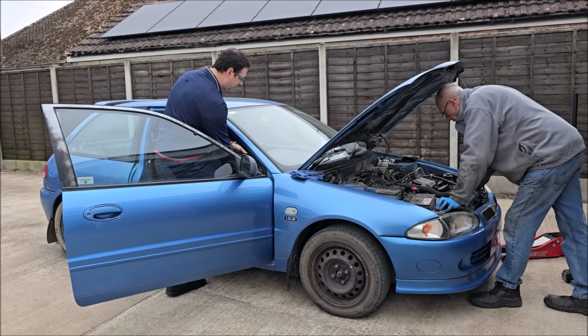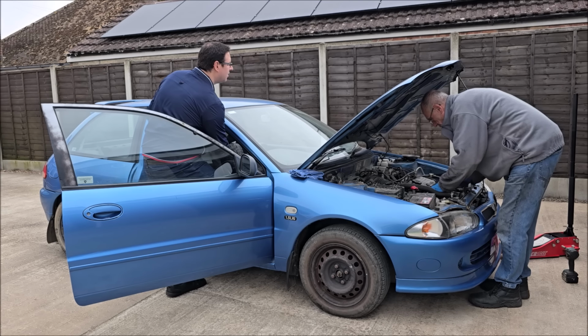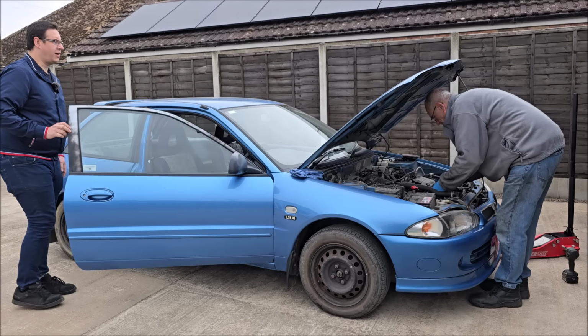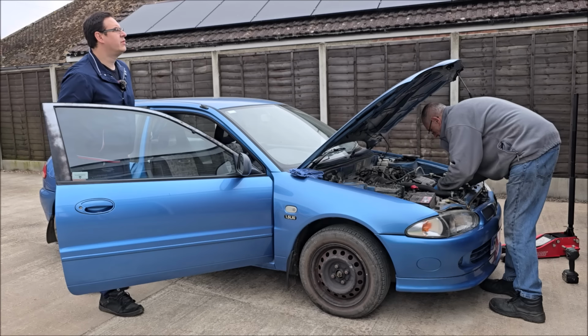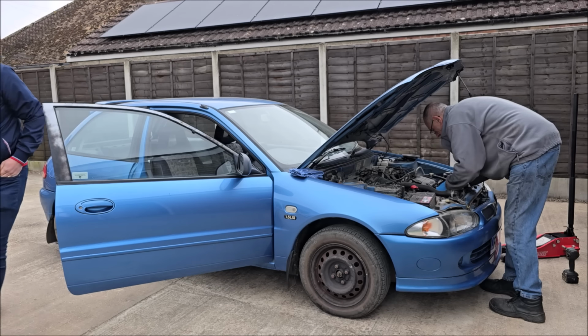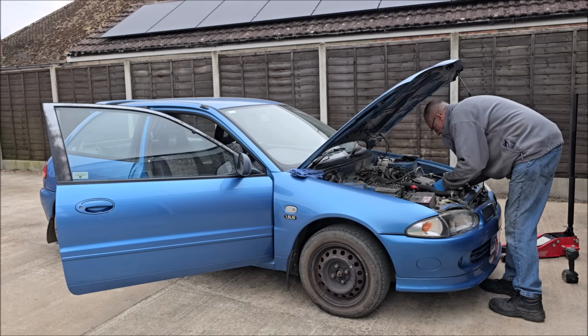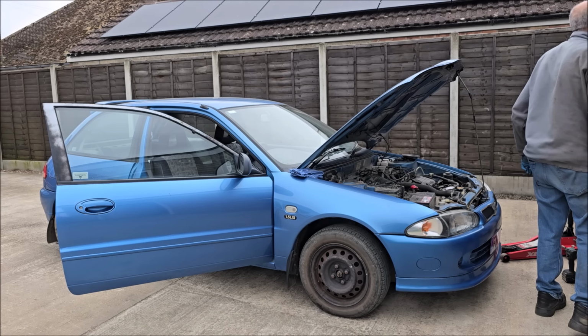Accelerator on. Yeah, go on. Right, 200 now. Oh, that's good. 200. It was at 165 on that valve. Next one we were at... Let's have a look. Well, write it down while you're there. Yeah, I'll write it down. Write it underneath number 4. Now 200. So 150 to beat.